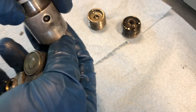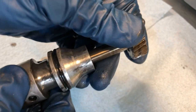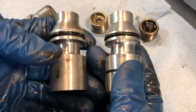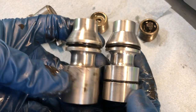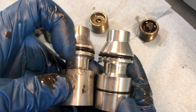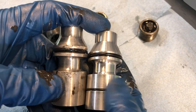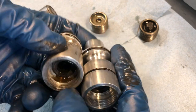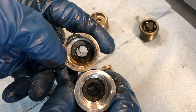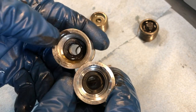Find a clean spot to disassemble the unit so you can either replace the seals or transfer parts to the new housing. Here we have the drive gear — this angled part is what we're reusing, and you can see why I loosened the coupler while it was still on the car. Here's the washer we'll need to keep, and the gear just pulls straight out of the top. You can see the differences between the two units: the OEM on the left has a single O-ring, while the 914 Rubber unit on the right has a secondary O-ring. There's also a seal in the bottom that can wear out, so make sure it's clean and replaced.